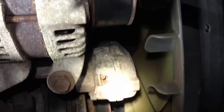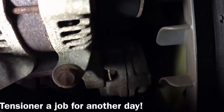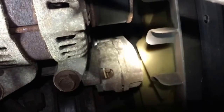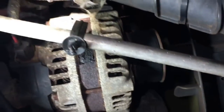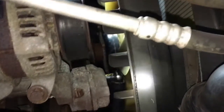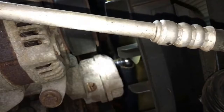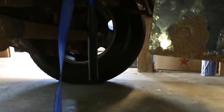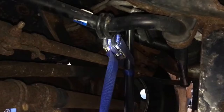First I'm going to have to get a hold of that tensioner. I noticed it looks like it's getting separated a little — I may need to replace that. I have to get up underneath the truck to get a 3/8 inch ratchet on the tensioner and give a pull so I can pull the belt off the alternator. The hardest part so far has been getting that 3/8 inch extension onto the tensioner. I used a come-along, cranking it to take the tension off of the belt.